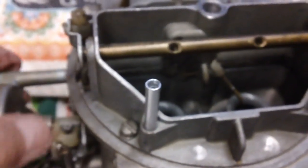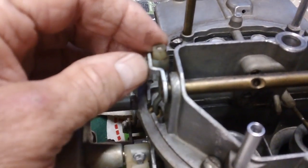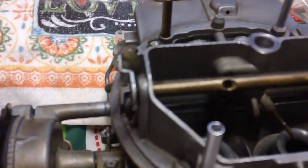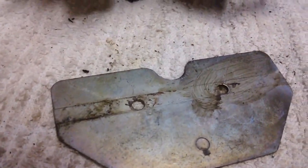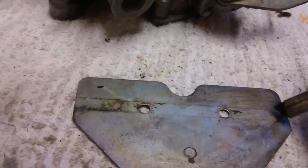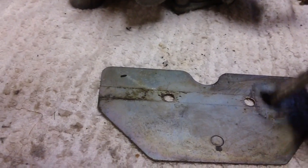It might be just a lot of crud buildup on there. It's definitely going to get cleaned up — I want that thing to flip back. This little piece here I may have to take apart and clean up too. It's been cleaned pretty good, but when you're dealing with plastic, all kinds of weird things happen. First thing I'm going to do is take a little lacquer thinner — I'll loosen all that crap that's on there, get as much of it loose as I can before spraying with carburetor cleaner. It'll save on the carburetor cleaner.